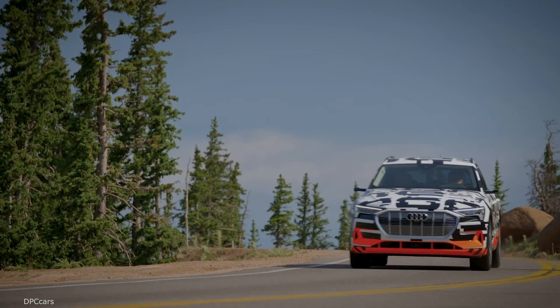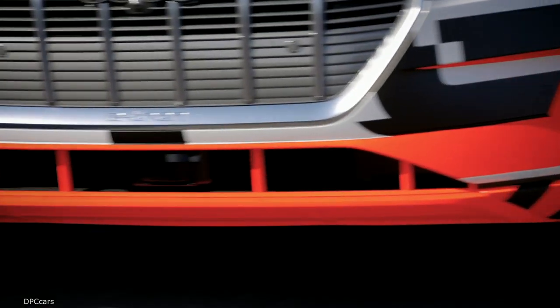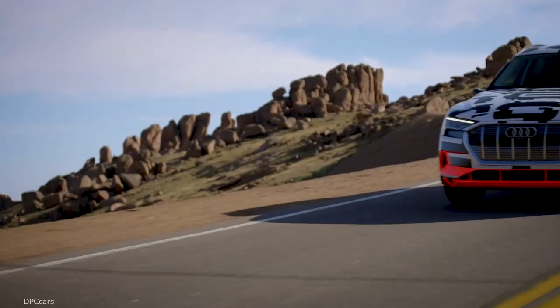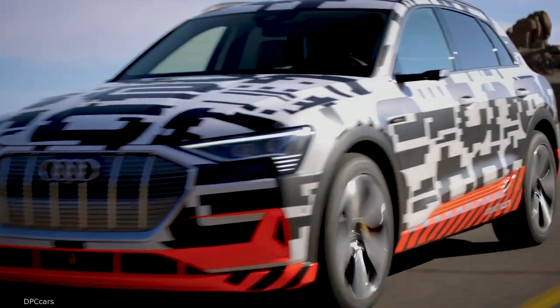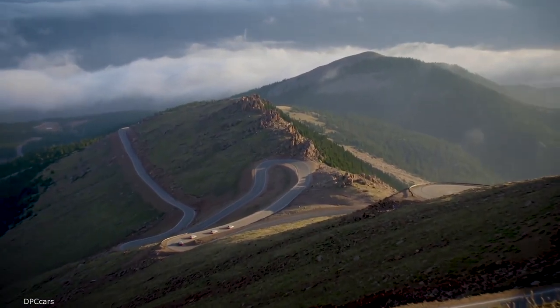This is wonderful — this feeling that the energy is not merely turned into heat and gone to waste, but is available for range. How efficient the recuperation system of the Audi e-tron prototype really is can be seen at the end of the test drive: 10 kilowatt-hours recuperated, 1,940 altitude meters and 29 kilometers of driving distance. For every kilometer we drive downhill, we get approximately an extra kilometer of range — that even exceeded our expectations. 31 years after Walter Röhrl's record drive, Audi is once again on a record-breaking scale at Pikes Peak.